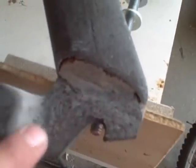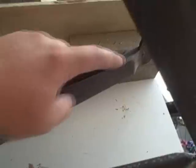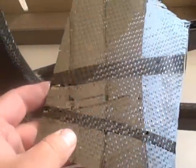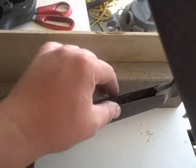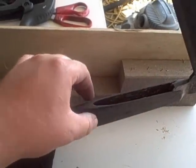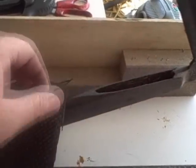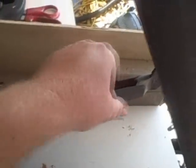You can see I had to sand a lot of this out, and I also had to make a cut right here because of the chain. What I'll do is — remember that little piece of non-structural decorative carbon fiber we did? I'm going to cut a nice little strip off of it, put it right on top of this with some 5-minute epoxy, and then wrap it with two or three layers of carbon fiber just to get it strong.